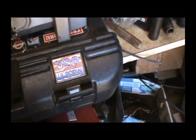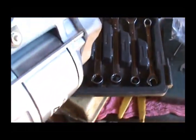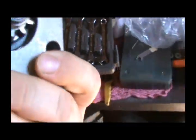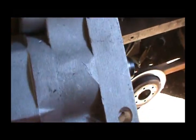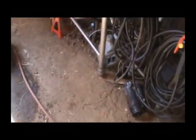We're going to get up under there and I'll show y'all what I'm dealing with on this other starter. Your solenoid is down here where the drive gear is, and your motor is up high where your solenoid would normally be. There's a gearbox in here that's got about a 4.4 to 1 reduction ratio in it, so it's very light compared to those big monsters — probably a third of the weight, and a whole lot smaller.